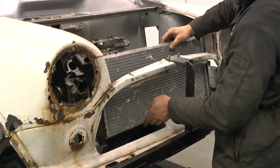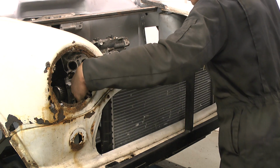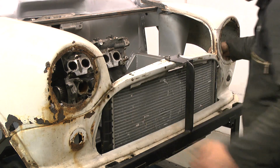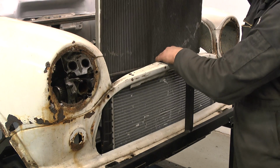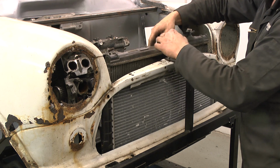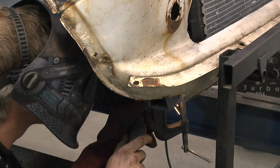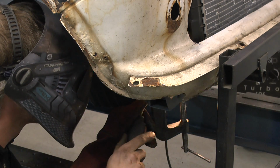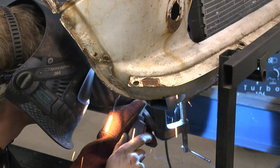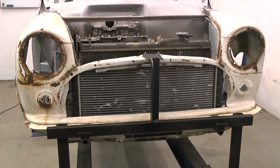The first of the radiators to go in is the one for the charge cooler, the Corsa rad. And the second is the engine coolant radiator from the Celica ST205, mounted directly behind. At this stage, the rad mounting brackets are only being tacked into place on the crossbeam. We may need to make some adjustments later on. And there we have it. The two radiators are now actually attached to the Mini for the very first time.